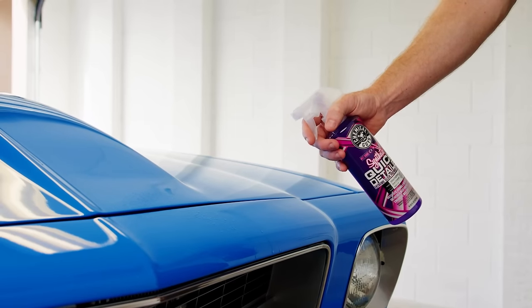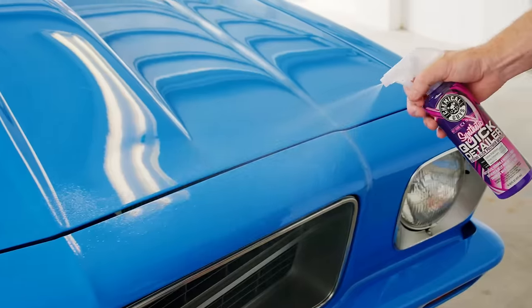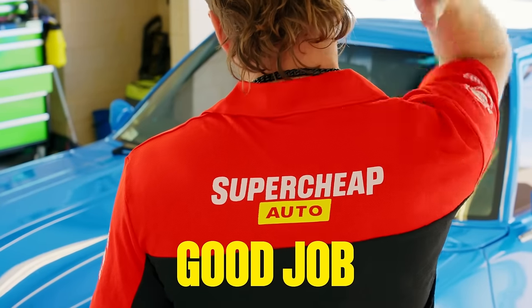You're not wiping away dust here, but you're not sanding a table either. Take a break once a minute. Add a squirt of detailer and wipe the area with a microfiber towel. Carry on in this way until eventually the scratch is gone. Then put down the microfiber towel and give yourself a pat on the back. Now, that's good for scratches — but what about swirl marks?